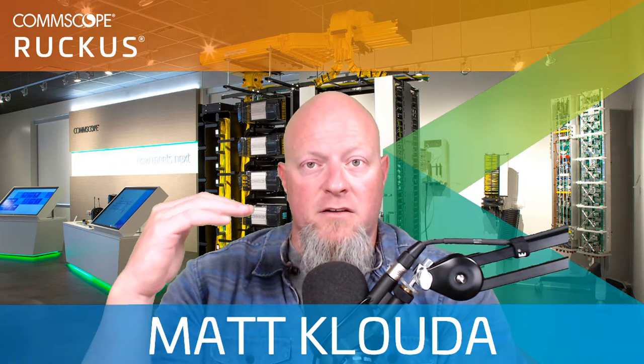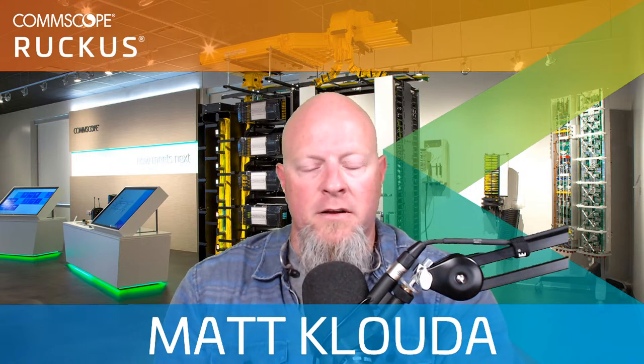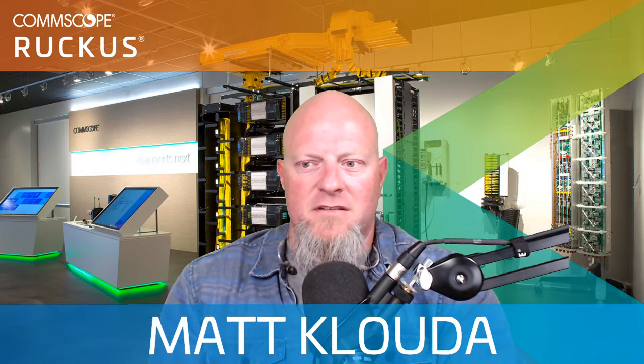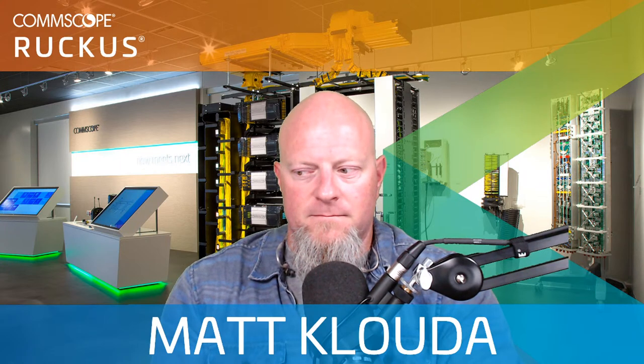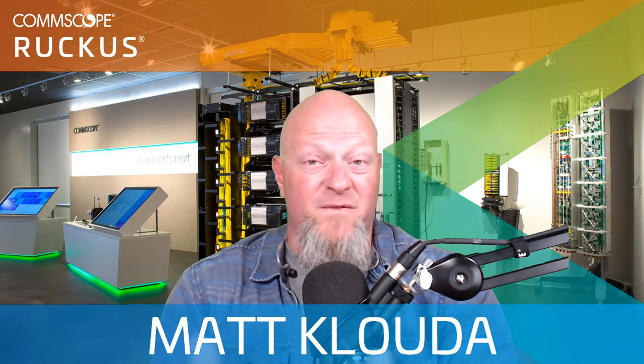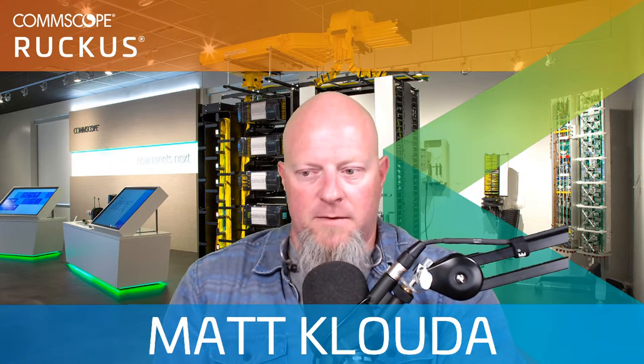Also on top of that, your Unleashed access points, I wouldn't allow them to provide IP addresses either. You're going to end up with conflicts, and the DSL modems and the cable modems aren't built to be able to configure that really. So avoid that at all costs if you can.